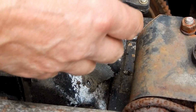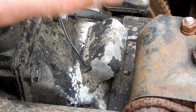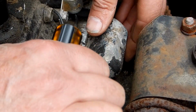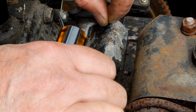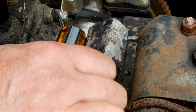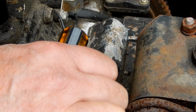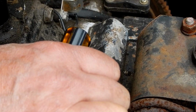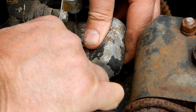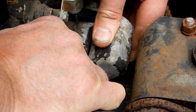In conjunction, the coil, which is an inductor, and the condenser, which is a capacitor, form what's called a tank circuit. All you need to know is that when that charges up to the full charge and those points open, that causes this to discharge its voltage rapidly into the primary of this coil, which will induce a high voltage in the secondary of the coil to make the spark. Got it? Yeah. It's really high tech. They've been doing this since probably like the 20s or the 30s.